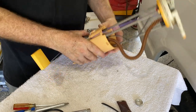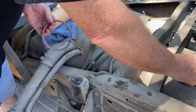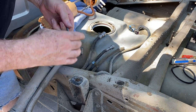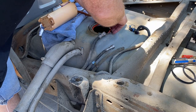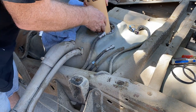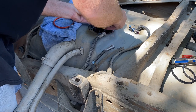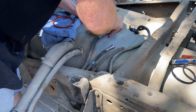We're ready to reinstall the pump into the tank. The two o-rings included with the pump don't appear to be the right size — this one maybe, but it's a different diameter than the original. I'm going to lubricate the original o-ring a little bit so that when we put it in it makes a good seal. I don't want to risk a leak because of the ring size difference. I'll make sure to put that ring in and get the correct orientation.